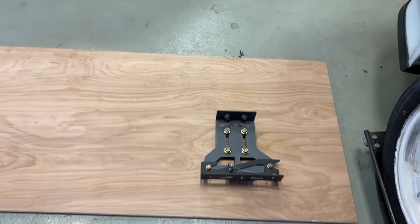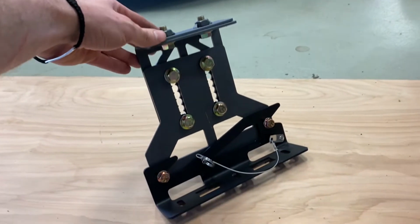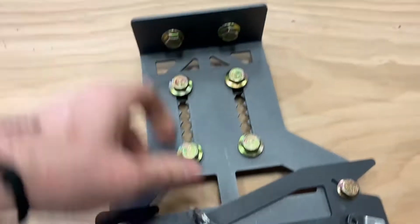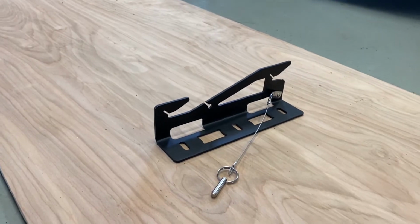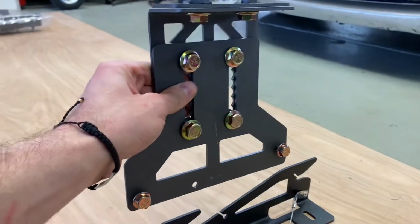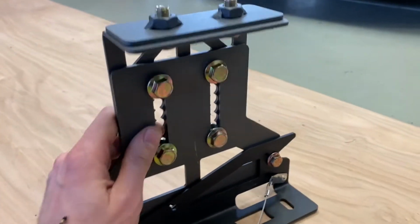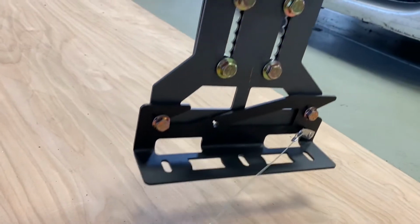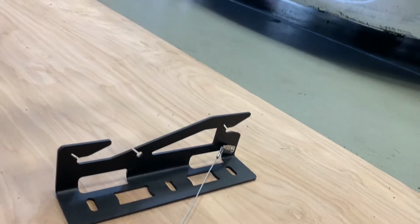I've never had a decent pair of splitter brackets, so I finally decided it's time, and a huge convenience, to get these race bred splitter brackets, which essentially have a pin. That part mounts to the splitter. This will be the splitter, this wood. This part is mounted to the chassis, and then you literally just slide the splitter, if I can do this one-handed, onto that bracket. You put the pin in there, and then it's secure, and then you're good to go. And then same thing, you pull the pin, you want to take the splitter off, you just slide the splitter right off, and that's it.